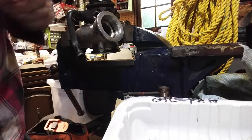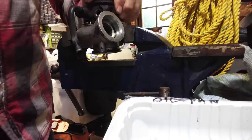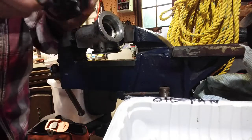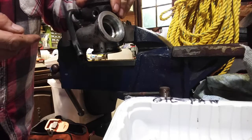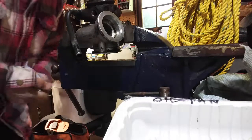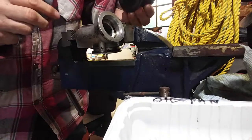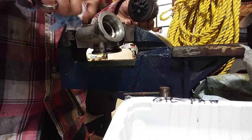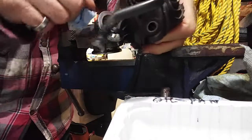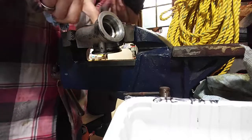It's off — I have to pull the turbo off now to get it out, which will involve the hammer again. I'll leave it in place for now, take a couple of pictures so it's oriented properly, then put the new one in. It only orients one way — there's a demarcation indent here and one in the turbo housing itself.